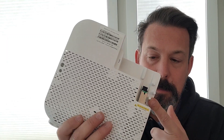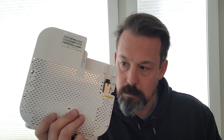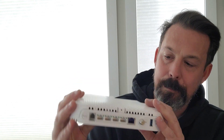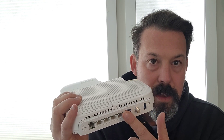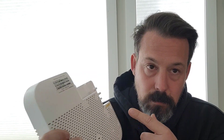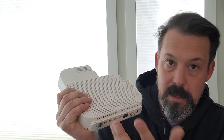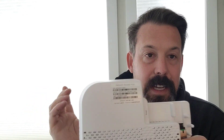You can take out the SFP and plug it into your router if you know what you're doing — and if you do, you're probably not watching this video anyway. This NAH router is the translator. It comes in here and then this thing pulls a public IP address — this is what talks to the internet, everything plugged in here talks to this. If you want to plug your own router in, you need to plug it in here. There's one trick to getting a public IP address and bypassing all of this, which is to log into the router and bridge one of the ports. You have the option to bridge the 10 gig port, just the four LAN ports, or all of them.